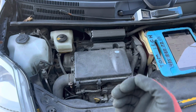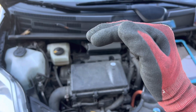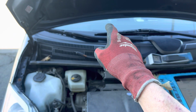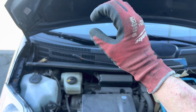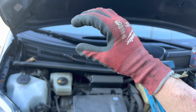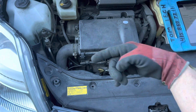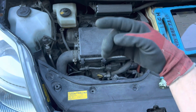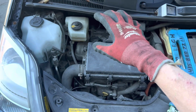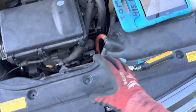and lack of oil coming back to the compressor, lack of a cool flow of refrigerant, because it needs a full charge of refrigerant for there to be enough extra refrigerant not only to cool the passenger compartment, but enough leftover refrigerant that has the capacity to absorb moisture. Yeah, it does that too. To absorb heat. So it goes back down into the compressor and cools off the electric windings, the heat of friction and the heat of compression that the compressor develops. So you cannot run them low, and when you run them low, you start overheating them, plus the lack of oil return.